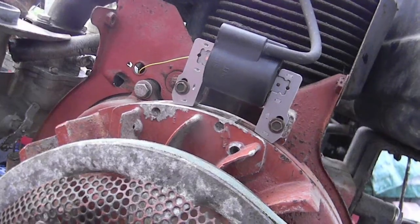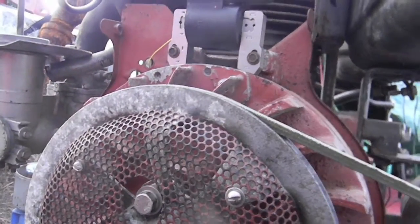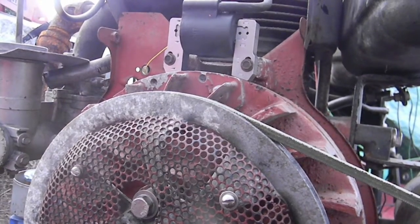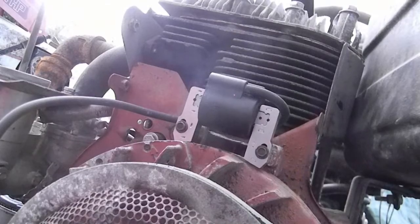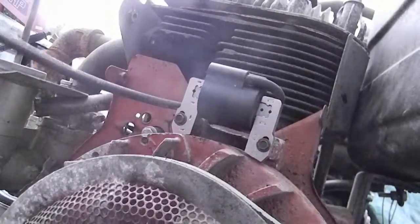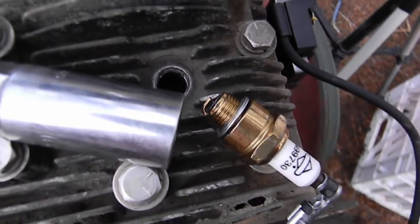with the new one, there is no spark. Nobody is home. And I tried shorting that wire at the ground, still no spark. Guess I'll try removing it now. So this thing's making voltage, but barely. Maybe it's a poor ground connection. I guess I could test that by putting the spark plug right to the end here. Coil's on backwards now. Sparking good.